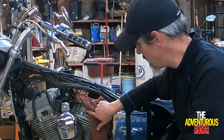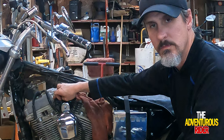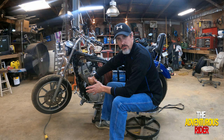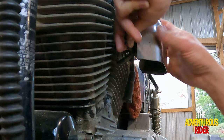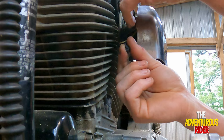As you can see, the upper engine mount is actually connected right here on both cylinder heads. So in order to unplug your horn wiring harness, you have them plugged in right here on the side and back here on the back side. And they're just two spade connectors that you have to unplug. And now we're going to just move them out of the way.